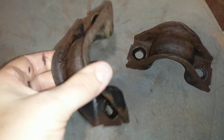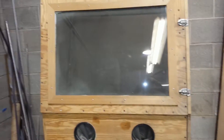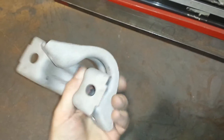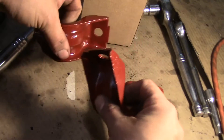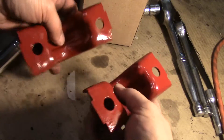These are the sway bar brackets. I'd like to clean them up and get rid of all this rust. We've got our sandblasting booth here. We're all set up and ready to go, and I'm afraid there is no way I'm going to be able to record this process because you wouldn't be able to see anything anyway. Two beautiful sandblasted parts. These are the brackets pulled off of the underside — after sandblasting them, priming them with a galvanizing primer, and then hitting them with rust preventative enamel paint.